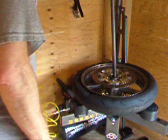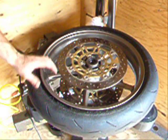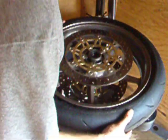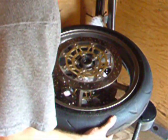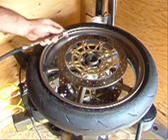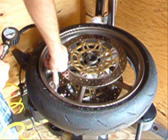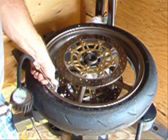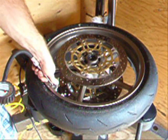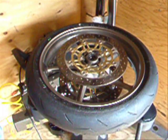And the tire is on. Sorry for a little butt shot there. Now all we have to do is get air in the tire. Don't forget, the first thing you have to do is unlock the camber block, pick the wheel up, and just let it rest — let the wheel itself rest up on the box. Otherwise you'll never get air in the tire. Once you do that, hook up your compressor, start pumping air. You'll hear it pop into place in just a second. There it went. Now we've got air in the tire. And now off to the static balancer. And that's it — Tire Changing 101.